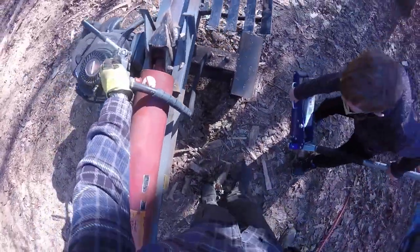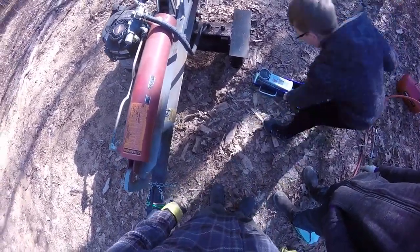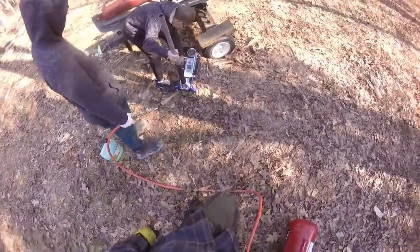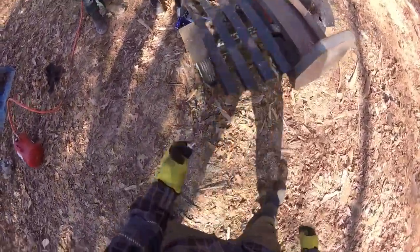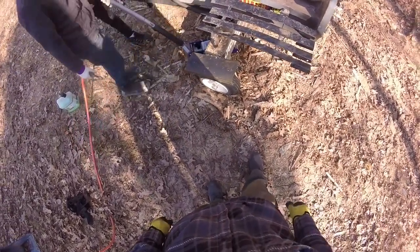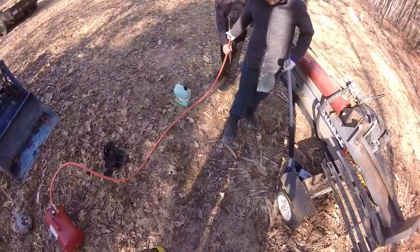So slide that underneath the reservoir there. And we're not lifting a lot of weight here, so there's really no concerns about punching through anything. And we also brought a strap, which is going to aid us in getting the tire bead seated, because most of the time when these tires go flat, they open up the seal on the bead, and you need something to get that started back on there. You can set that down because we won't need that for a while.